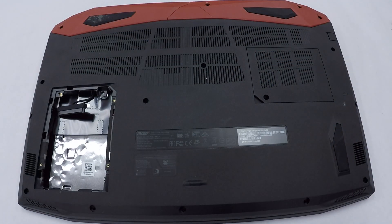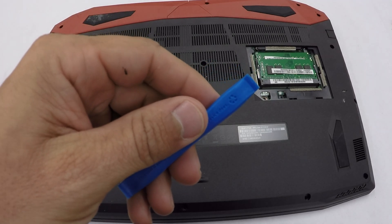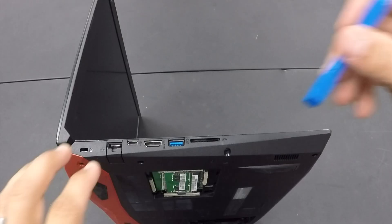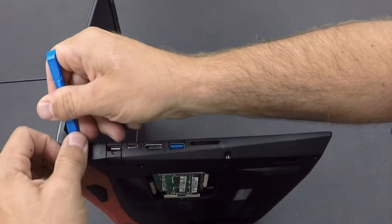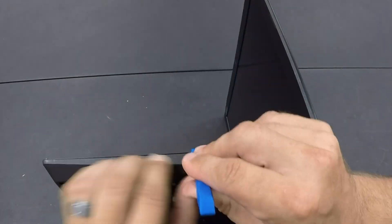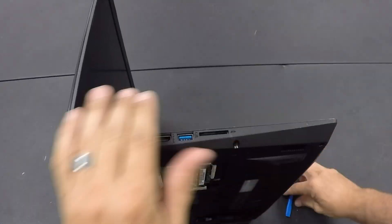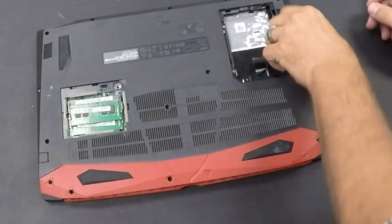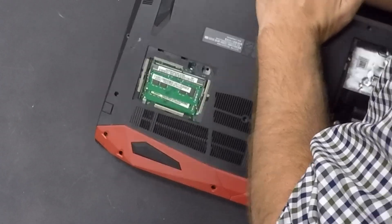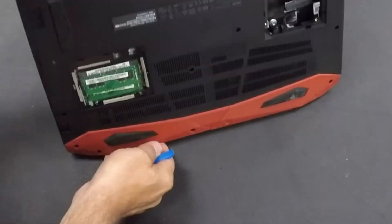It's just in two small compartments. Now the pry tool is what you're going to need to use to separate it — probably the most tedious part is removing the back panel. You're going to want to take a nice edge and work around the sides. I've actually discovered that it's easier if you work from the front and not the back of the panel. If you can get the front to separate, that will allow you to pull it off a little bit easier.